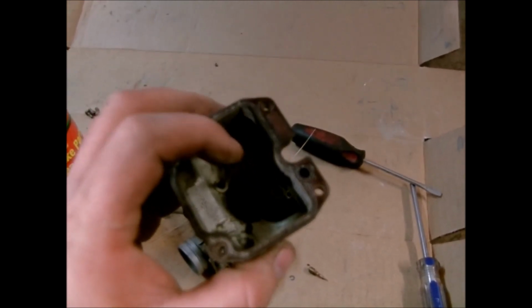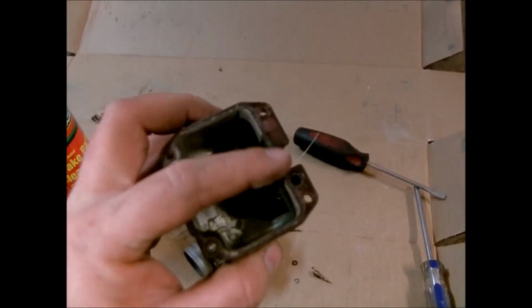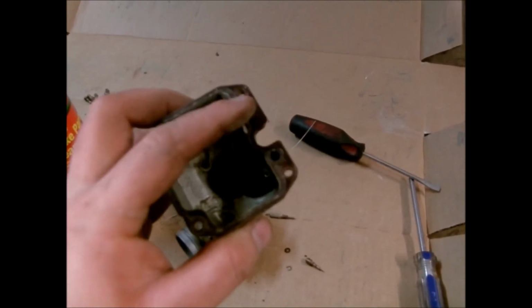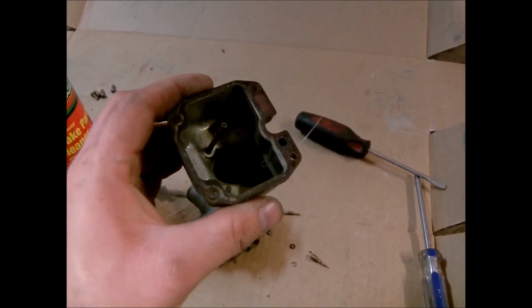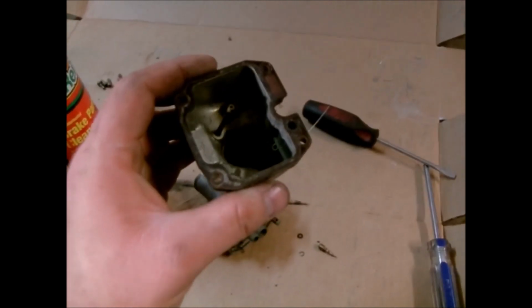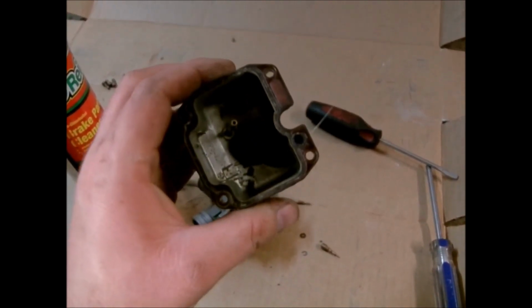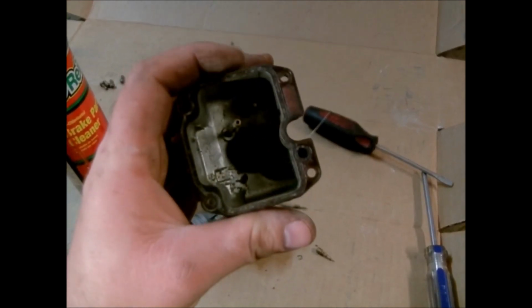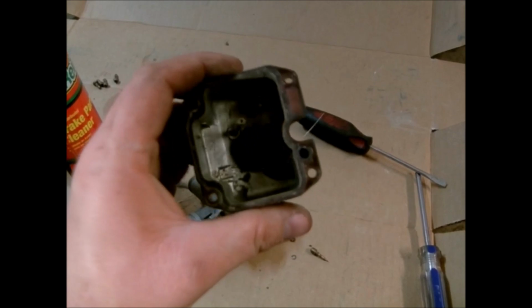Of course I want to wire that tube out and clean it out and everything, but the reason I'm not going to is because I really don't need, other than this one gasket, I really don't need a rebuild kit for this, because everything is cleanable so far. And if I put this whole thing in there, then the B12 chemical dip will dissolve this gasket, and then I'll have to end up trying to track down a new gasket. So I don't feel like driving all over town just to try to find that.